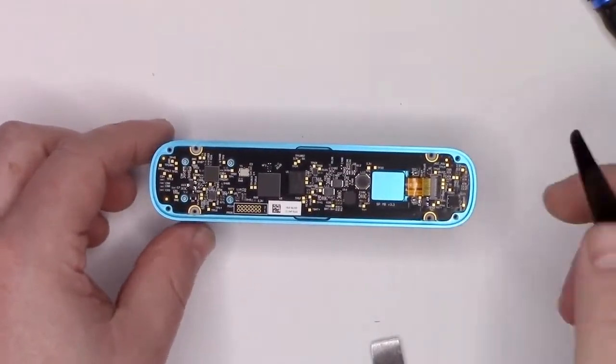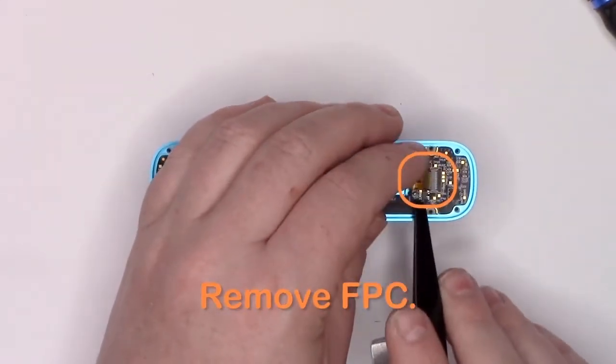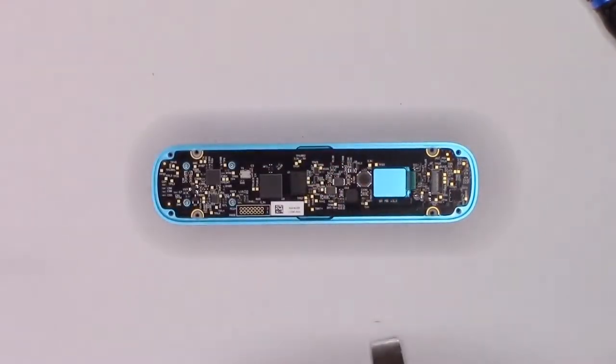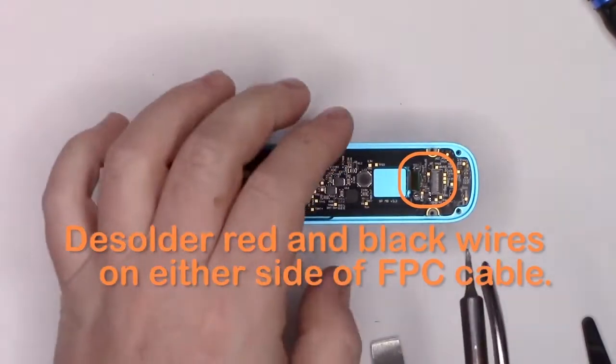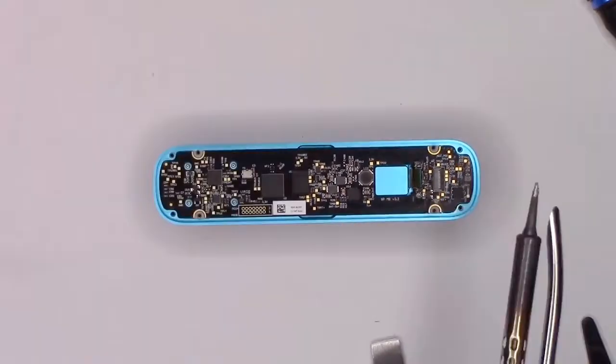There's our first look at the main circuit board. Remove the FPC cable, and on either side of that cable you'll see a black and red wire that hook up to a thermoelectric cooler. You must desolder those two wires to be able to remove the main circuit board and access anything else in the case.